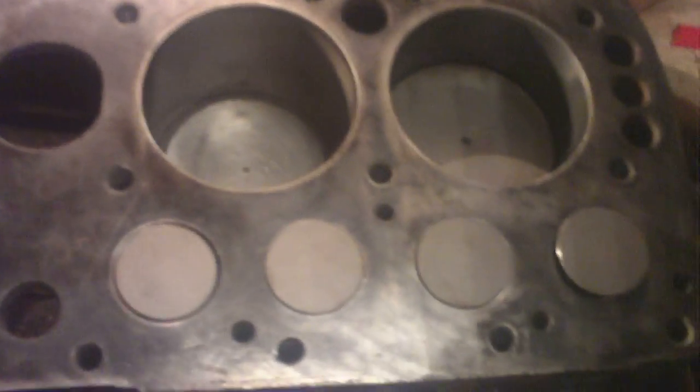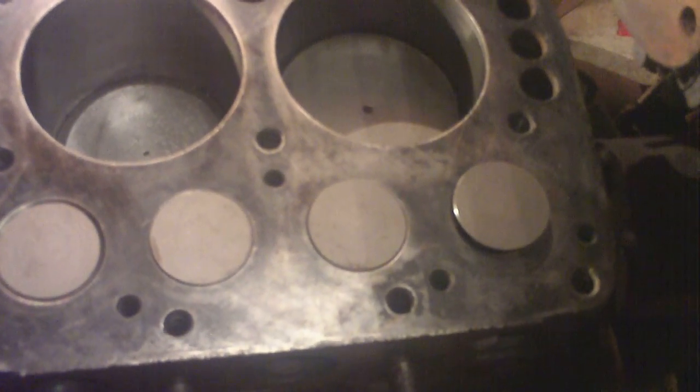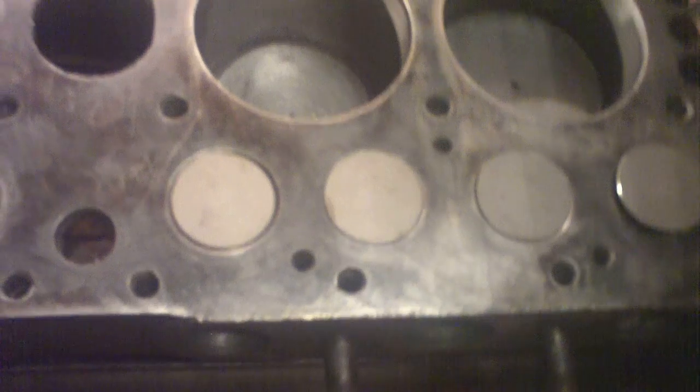It's been a while but I figured I'd do a video on the Fordson rebuild. It's been a couple months since I made a video. I managed to get all the pistons back in with all new rings, all new valves are in the motor, six new valve guides, a couple new valve spring keepers, a couple new valve spring retainers. All the seats were ground in this motor, and all the cylinders were honed. It's coming together — finally getting there one step at a time.